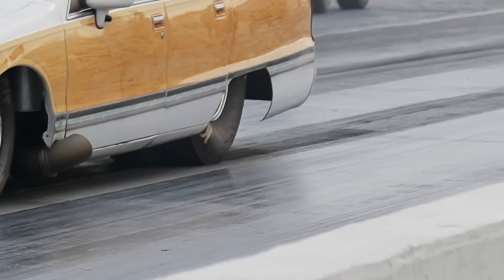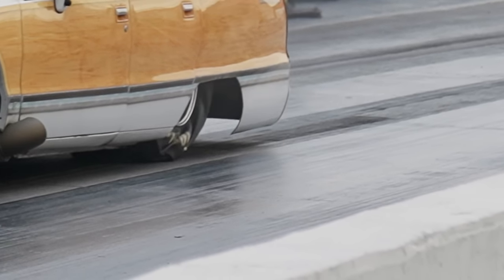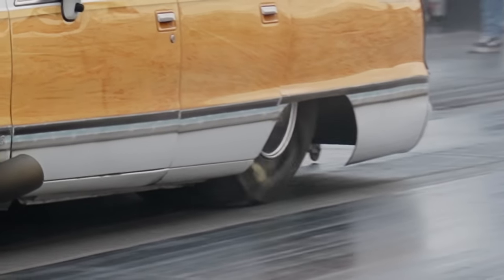What we're doing is, I don't have the tools here to put any more rear steer in it, and I really don't want to mess around with that anyway. It is really killing the tire if you look at the launch. So, launch on both of them, you'll see just wadding the tire, just killing it. So we're just going to add tire pressure to it and go back out and make that exact same pass and see if that helps.